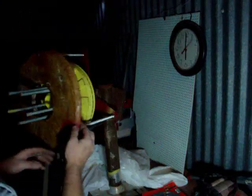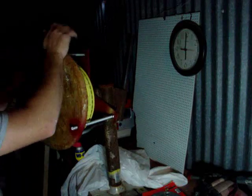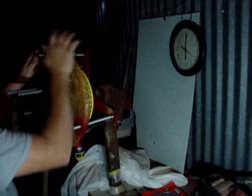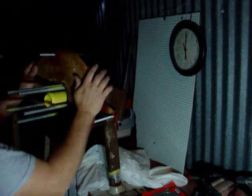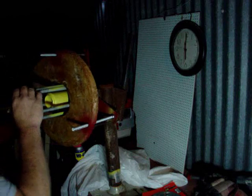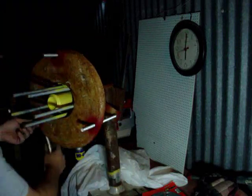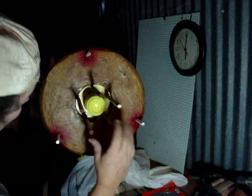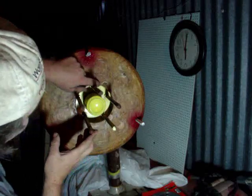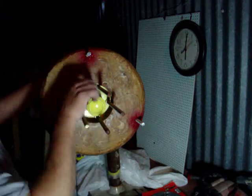That fits good. One is a little snug. That one leans out — might have to tap it in a little. We'll see what it does first. We don't want to do any bending on anything. Take it all the way down. The top one seems to be a little snug. We're all the way against the magnet rotor. Let's tap it out just to touch — that one wants to ride nice. Spins and doesn't touch. It comes mighty close right here, got a little more of a gap there. I'm going to go ahead and tighten these up and see how she'll spin.